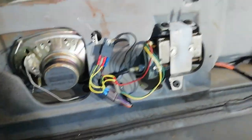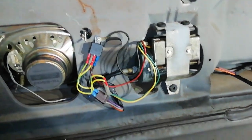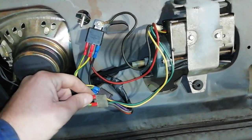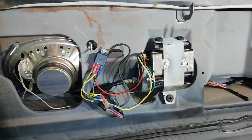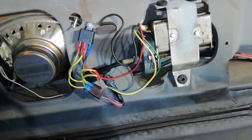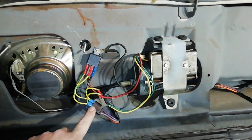As I've been saying, the roof was working a little bit rough and slow. Now when I removed the back seat, I noticed that somebody has already put in a new relay, which is good. But these connections here are very weak, and the current going through there will have some problems. I think that's the reason why the roof was working so slow — because the motor cannot get enough current to move efficiently. I'll be fixing this, but I'll look for a way to keep the original connectors. Never change stuff like that on an old car — keep it all as original as possible. Maybe I can find another relay with the correct connectors.